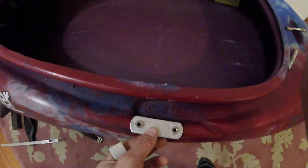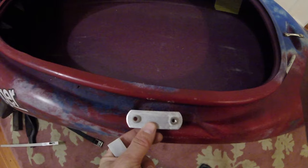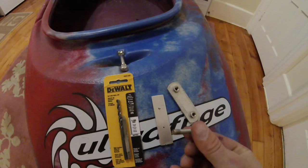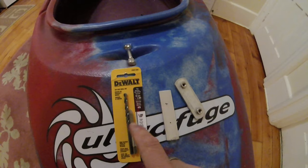It really doesn't matter how precisely long. Why not just use the old mounting plates? Back in the day, they screwed them much closer together. Even though this spacing is standard between both Piranha and Dagger, it's worthless today. So we're going to take these new aluminum blanks, try to center them underneath the existing drilled holes, and mark with a sharpie. With the holes marked out on the blank, I'm going to drill and tap them to accept the standard Dagger and Piranha bolts. That requires a drill and tap set — a six millimeter by one.